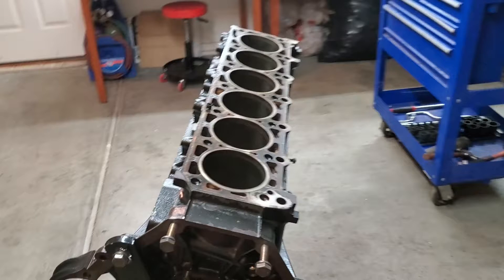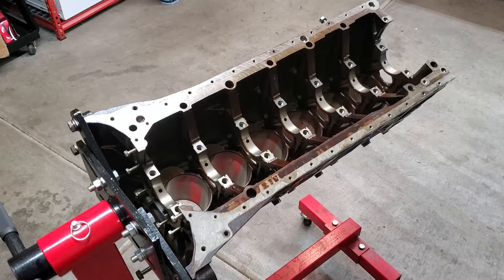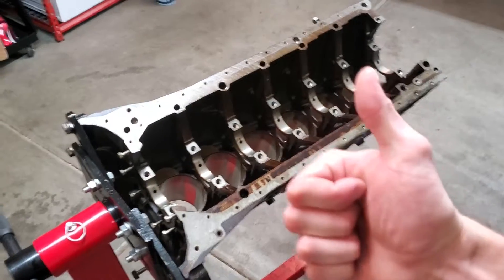Let's take a look at the internals. First we have to look through the engine block. We'll check the top deck to make sure it's flat and that there's no pitting or anything like that — make sure that the surface is reusable. Then we want to check the bores to make sure there's no damage. Now we'll take a look at the block from the bottom side, check the oil pan surface and the bores from the bottom side as well. Check.